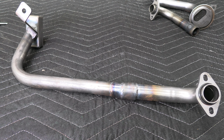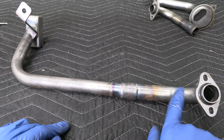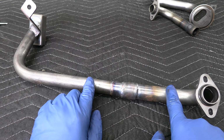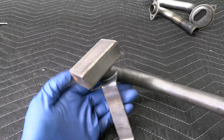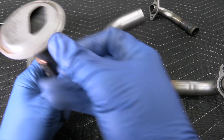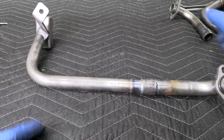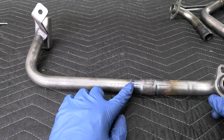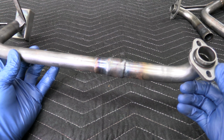All right, so this is my oil pickup pan. This is right here. This is all Predator pickup. And then from here, this is for a Coyote motor. And this is what Moroso made right here. You can see it's got a different kind of strainer pickup there. But yeah, this used to be all Predator right here, and then I cut this off and welded on my Moroso strainer here so this would work with my Moroso 8-quart oil pan. So little custom modification so that that would work.